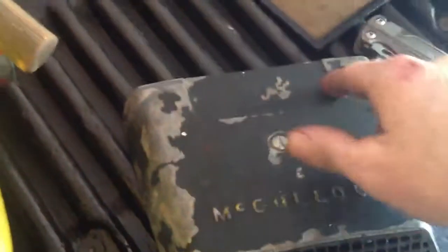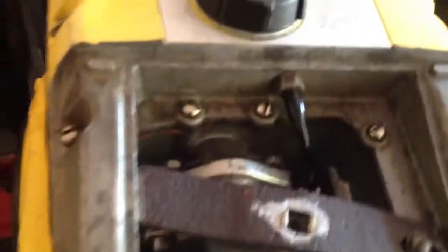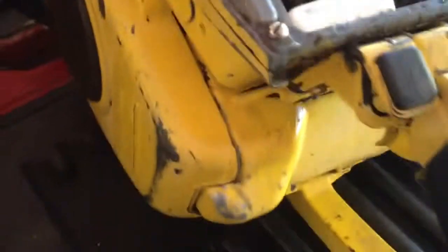The air filter is decent. The nameplate is missing here — this is homemade. This saw is probably going to need the carburetor gone through, and will probably need a fuel filter and a fuel line as well.